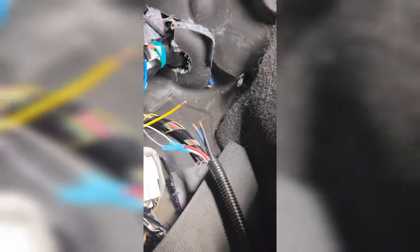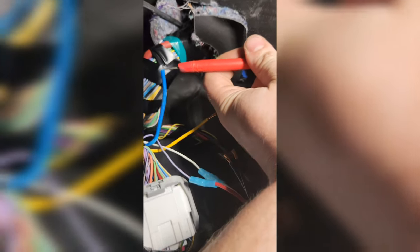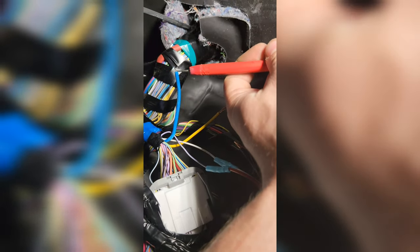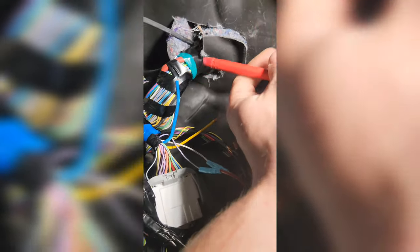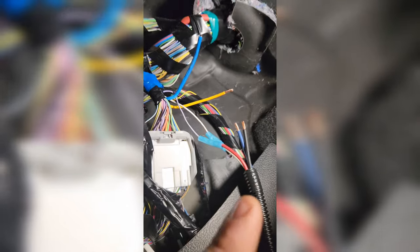The last thing we want to check is the blue wire, which should be the pass-through. With our ground hooked up, we touch the end of the wire — we have no volts. Switching our multimeter to continuity, we tap it — no beep. So we know for a fact that this wire is neither powered nor grounded, which confirms it is the pass-through. Our black wire is going to go to the yellow with the trace, and blue wire to blue wire.